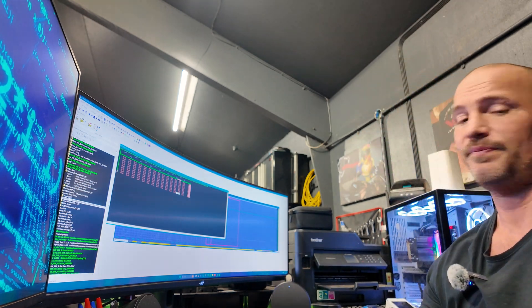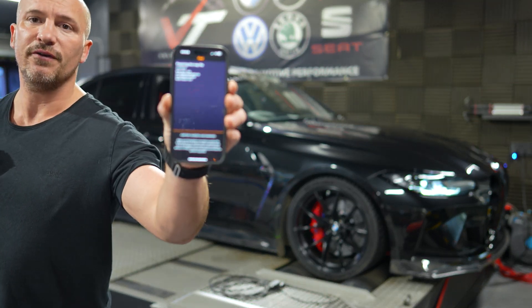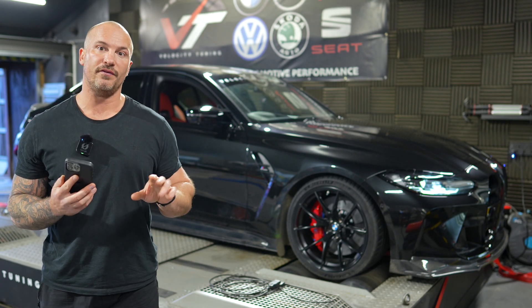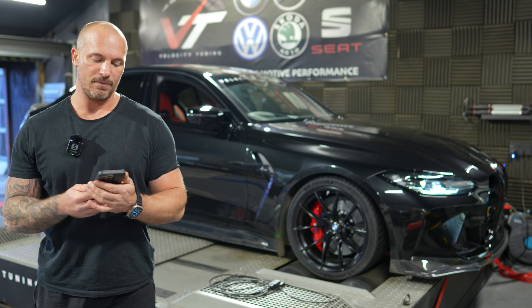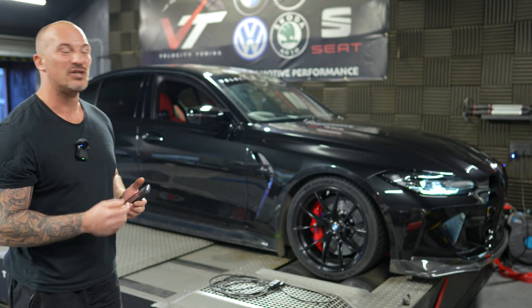We're just going to run it up and see how close we can get to 800. I reckon it's not going to need a lot of boost to get there, so I'd rather start with one and a half PSI and see how we get on. The map is written on the PC, I've transferred it over to the phone, I'm now connecting to the car and going to flash in that map. We're going to run it back up on the dyno and see how much extra power we're making. I did talk about live mapping, but I'm not quite set up for that yet — I'll use that when doing the meth mapping. This should just be a quick change.